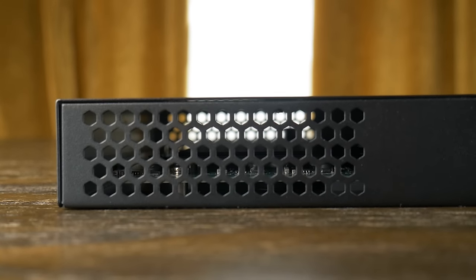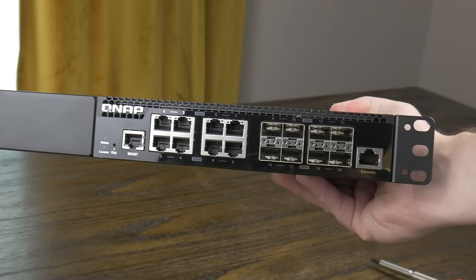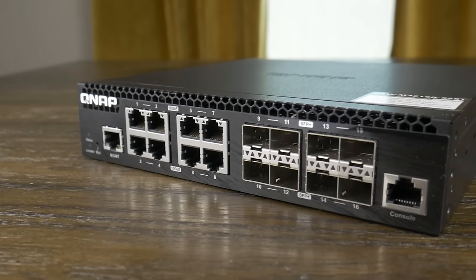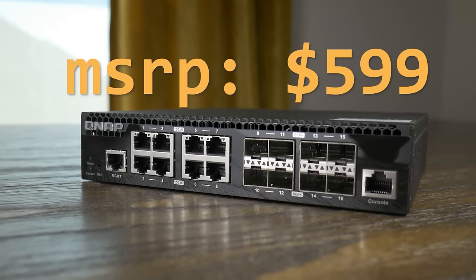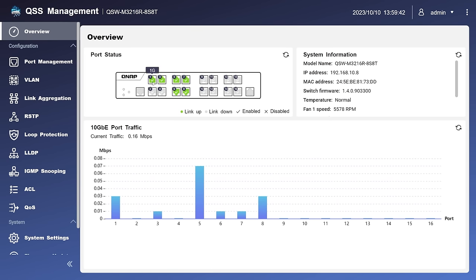This thing is completely passive and only draws a few watts — the power supply is only 12 volts at one amp. Originally I had planned to buy two of these or one plus a slightly bigger version, but QNAP actually reached out and offered to send me some switches. They sent me the big switch you may have seen in my last video, which has eight RJ45 ports supporting 10 gigabit (plus five, two-and-a-half, and one gigabit), and eight 10 gigabit SFP+ ports that also support SFP. This switch just launched at around $600 MSRP. Setting it up in my last video I had absolutely no issues, and it's run without a hitch — no issues with auto-negotiation on two-and-a-half gigabit or one gigabit.